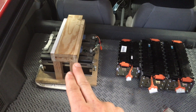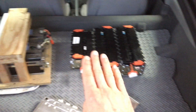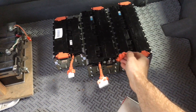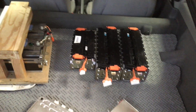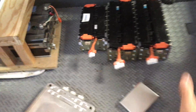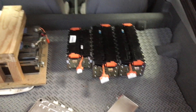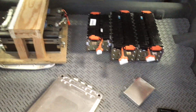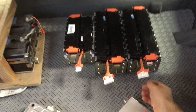They will fit in the bay, so you need three of these and one of these - it definitely fits and fits very easily. It's also got really good electrical insulation, so you could be a little more cavalier about how you install these in the bay. They do have bolt studs on the end, so I would recommend making some kind of carrier that screws into those - you don't want these just sloshing around. If you have an accident and these get punctured they're going to catch on fire, which is kind of the theme of today's video.